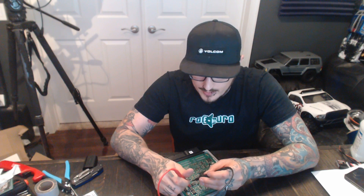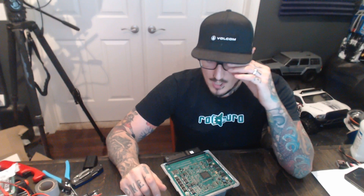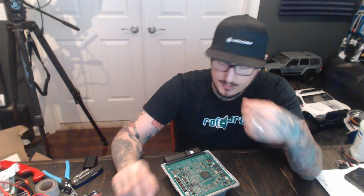Testing right on injector five — we got full connectivity. That is a bad MOSFET. Testing injector six: left is fine, center and right are fine. So my injector five MOSFET is obviously bad and needs to be replaced. It's such a cheap part — roughly $19 for 12 of them from DigiKey. I'll put the link in the description. That'll let me replace all of them and have a spare set of six.